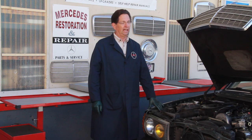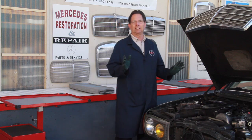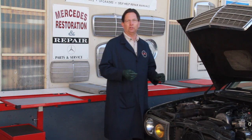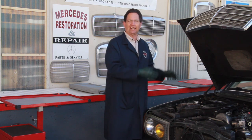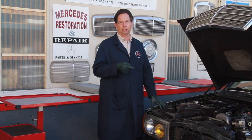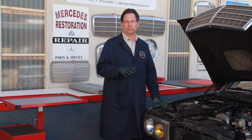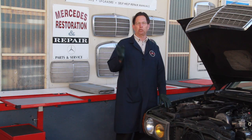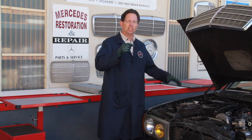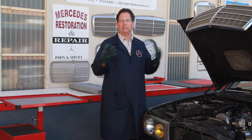Be prepared — when you pull that head off the engine you may not like what you see on those cylinder walls. At least with the commitment to take the head off, we can decide whether it's worth replacing the head or replacing the head gasket. Over the next few days we're going to go through a few tests — a coolant pressure test to see if we can get a leak-down, which may indicate something going on with the head or head gasket, and a cold cranking compression test to see how much variation we're getting between cylinders. After that we'll report back, and once we think we know the problem, we'll pull the head off and inspect the gasket and the head.